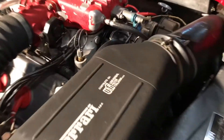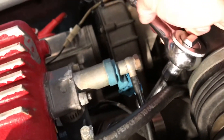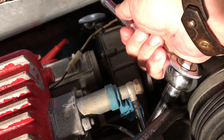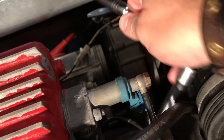We're on the right side of the car and right here is the bolt we're going to be swapping out. I've got a 13 millimeter socket on my wrench — I've pre-loosened this because I'm working one-handed. When you free the bolt it's probably going to be pretty tight, so be really careful — as you pull it you don't want your hand to boomerang back and get a cut. Remove this bolt and the little washer and replace it with the new one. Be really careful you don't want to drop this.